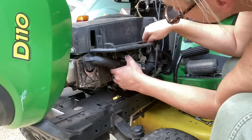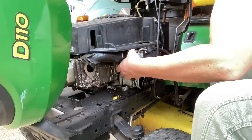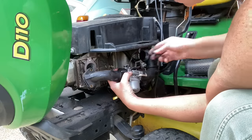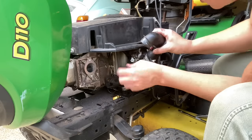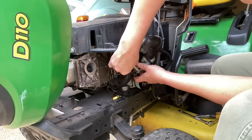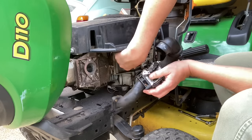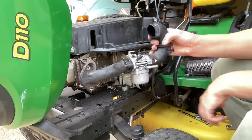We're going to go this way to remove the choke, just like that, and then get this cable out of the way. We're just going to turn the carburetor this way and take them out of the top — just like that. Almost stretched out my spring; there's a little spring along with that lever, so make sure you don't wanker it out. Now we've got everything off.